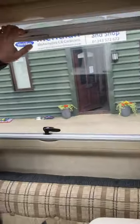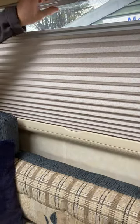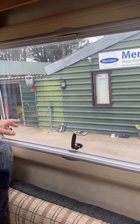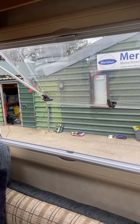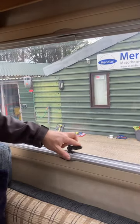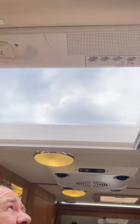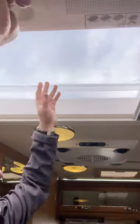Lines and windows — all the windows have fly shades with a clip on that holds them together, and night shades. Night shades don't have a clip; the clip only works on the fly screen. To open the windows, undo the latches, open it and you'll hear a click — at that point it stops. If you want it up more, go to the next click point. To bring it down you have to go right to the top and then it will drop all the way down — don't force it. Make sure all your windows and roof vents are closed when you're driving. To close it, wind it all the way down until there's a bit of resistance. When you unwind it for the first time in a while, help it up because it can stick to the rubber.